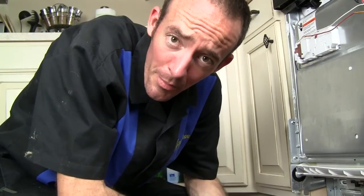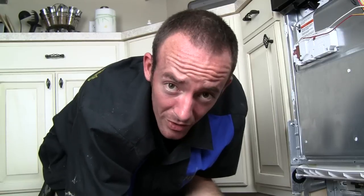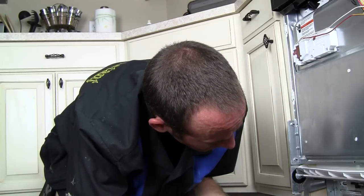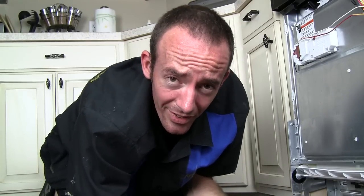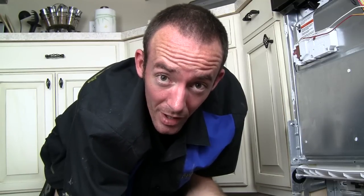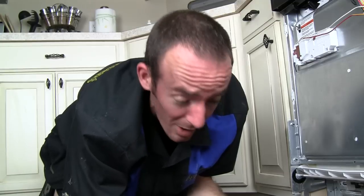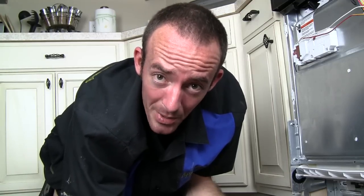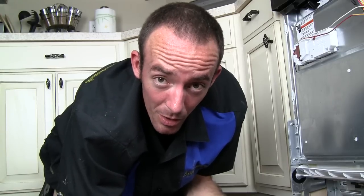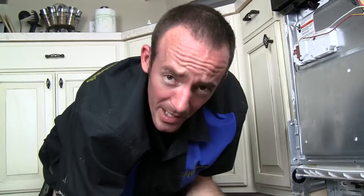One other important thing: you need to be absolutely positive that all of your connections are 100% dry. Even small leaks over time can cause major damage to flooring and cabinetry. After everything is working properly, sit there for an extended period of time and look underneath the dishwasher to make sure you don't have any drips or leaks. Leave that lower panel off for a day or two and check periodically while it's running. A good trick my grandpa told me: place a red or colored napkin under there — if you had any leaks that you repaired, it will leave a mark on the napkin you'll be able to see even if you don't catch it at the moment. That's about it — thanks for watching.